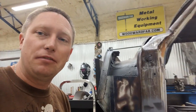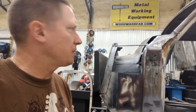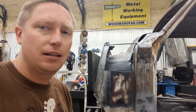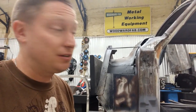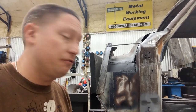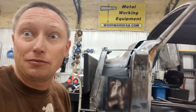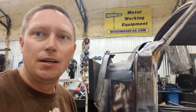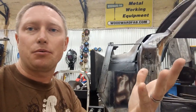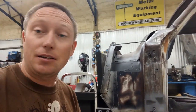So that's my epiphany: if you're doing a job like this, sandblast everything down, have a look at the inside before you make your decision about what you're going to do. I made the wrong decision. And granted, I went ahead and decided to finish with the route I'm going here, because after you're halfway through, at that point, it's like I might as well finish versus trying to cut everything out you've already done and weld a new piece in. At some point, you're far enough through the process that you might as well just continue forward.